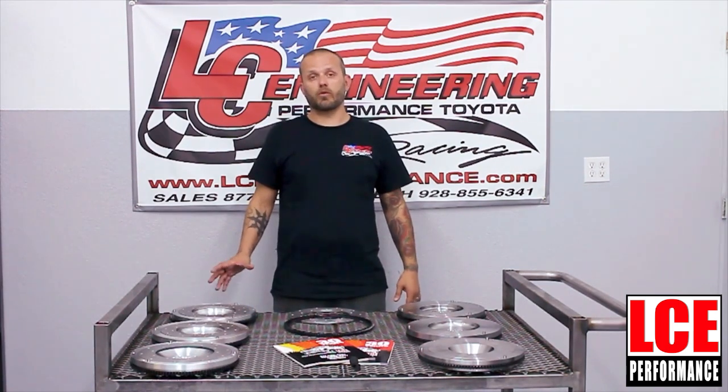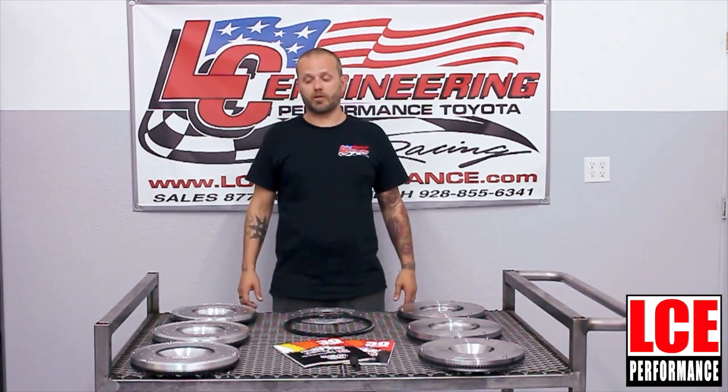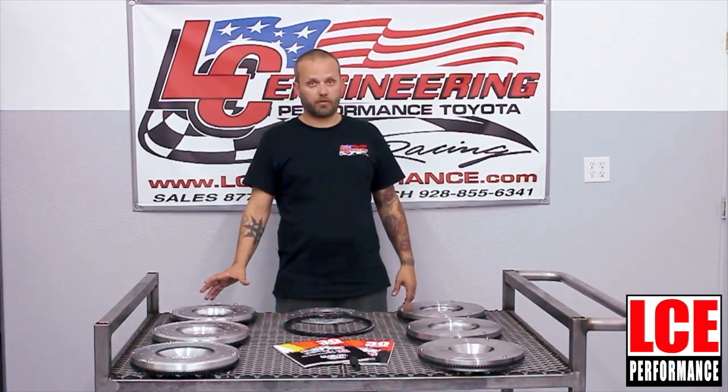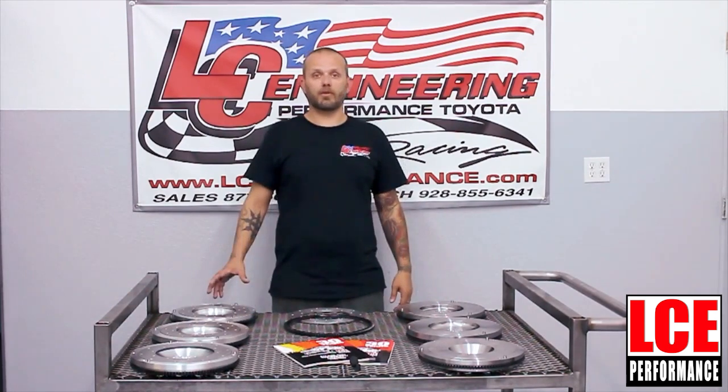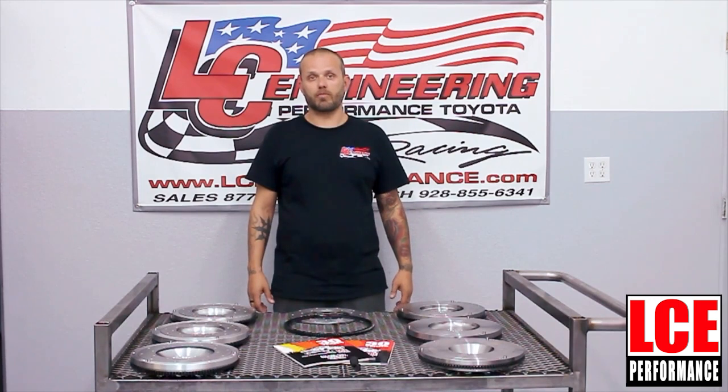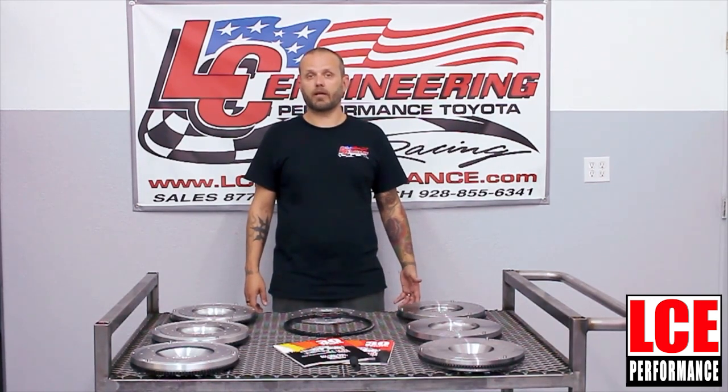Most are unaware of the job that the flywheel does. Depending on your application, we would recommend either a lighter than stock flywheel or a heavier than stock flywheel for your vehicle. The job of the flywheel is to carry the momentum of the crankshaft with enough energy left over to compress the intake charge with minimal drops in RPM, which could negatively affect the engine as ignition would occur earlier, putting quite an extreme load on the crank bearings.